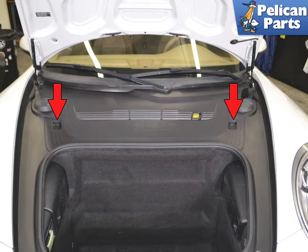The manual clutch uses brake fluid to pressurize the hydraulics. It gets this fluid from your brake reservoir. When bleeding your clutch, make sure to use fresh, unopened brake fluid.